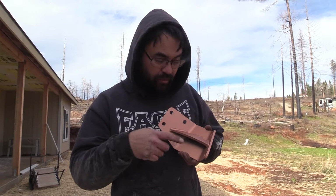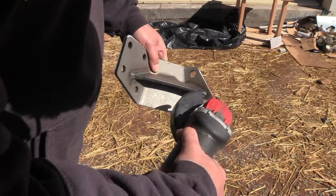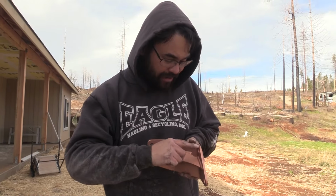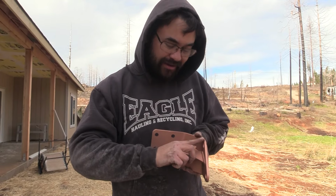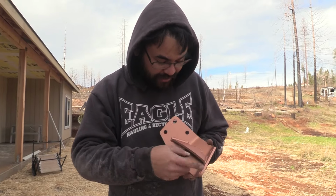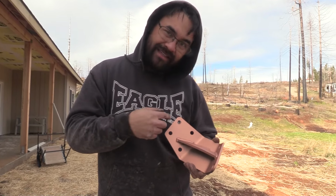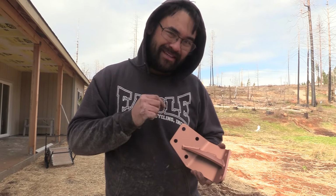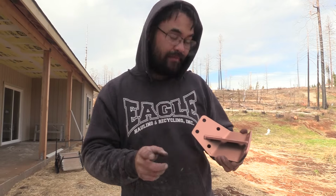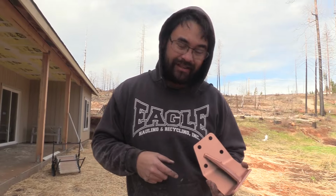We painted this with some weld-through primer, and I really softened the edge up here, because it goes right next to the water line, and I know the water line doesn't rest on it, but it does hit it sometimes after you remove the skid plate. So I softened the edge there, and then Lauren painted it in this weld-through primer because even though we're bolting it, we think we might want to weld it because it is recommended, but we just don't have the welding tools here. So this will be prepped and ready to weld in the near future if we do it. Pretty color though, I kind of wish we could leave it that color.